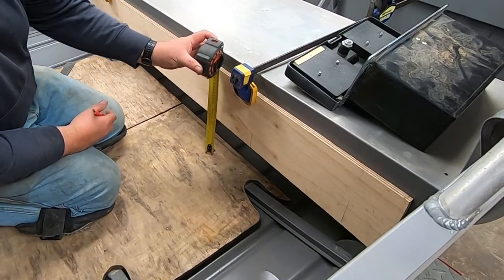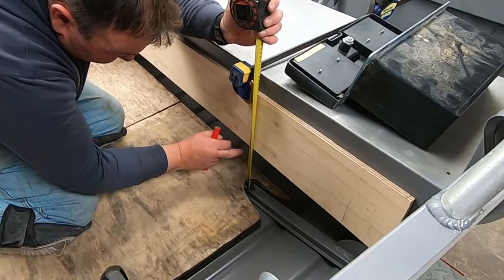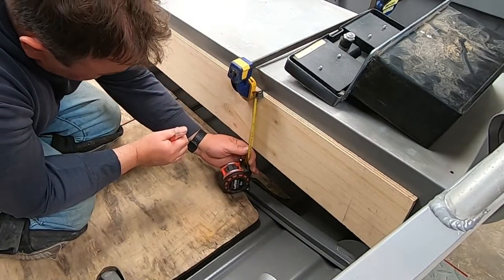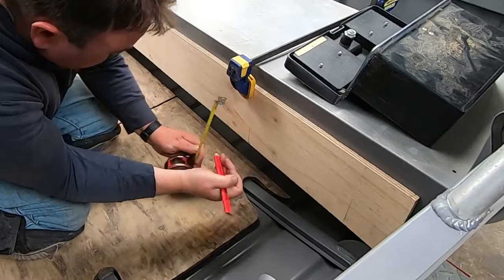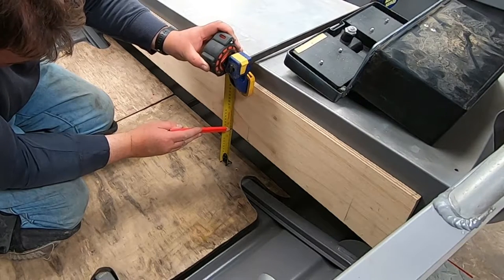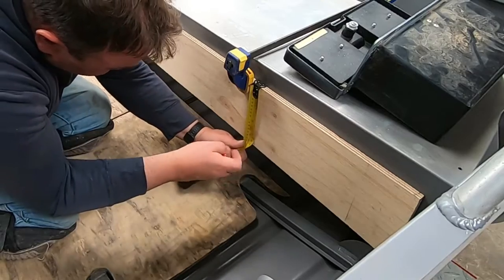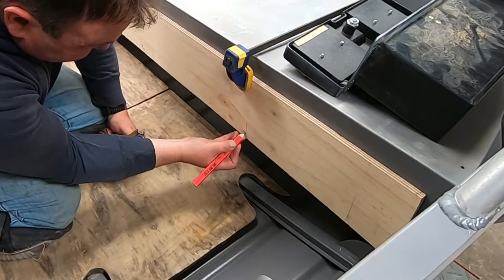So, just pick a spot anywhere on the boat. So this point here, the lowest point there, to the bottom of the boat here is 150. So it's going to be 165 down from the top. 165. Well, that's coming fine. And this one here, so it's going to be pretty much 140 plus that 15 we're talking about, so 155 down. So down here is that way, and that's going to be our floor.